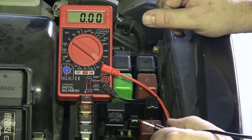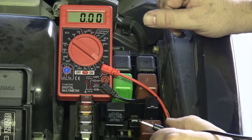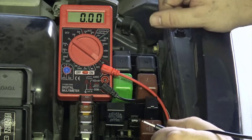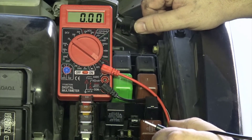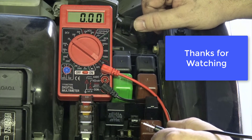At this point, we know that this electrical circuit completely works for both the control circuit side and the switch circuit side. If the horns really did not work on this car, then I'd be seeking to replace the relay. A faster way to diagnose this problem might have been just to switch the relay and put it in that location — if we knew this relay functioned correctly — to test our relay for proper functionality. I hope this tech tip helps you with further relay testing.